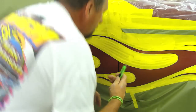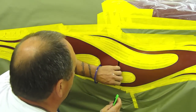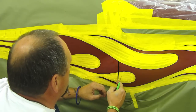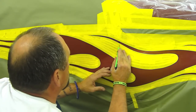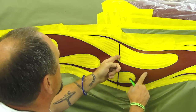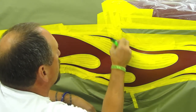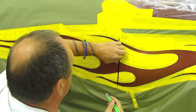I got it all masked up here. What I do is take a razor knife and cut right down through the middle of the gap between the front fender and the door, and cut down a little ways here also. Then I tuck those back in and take pieces of tape and fold them over inside so there's no blow-through — it goes back up onto the vehicle itself. If this was a candy job and paint went back underneath and got on your candy, you'd have a horrible mess trying to spot all that in. So just as a precaution, I cut every single one of them and tuck them all.